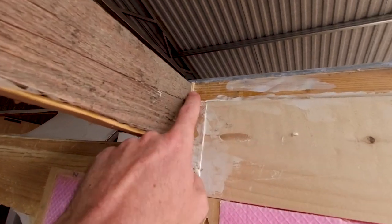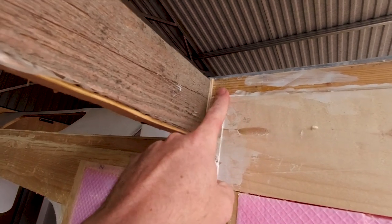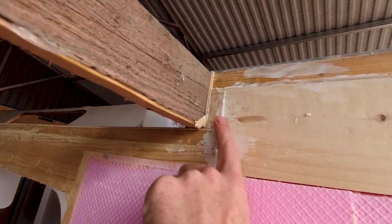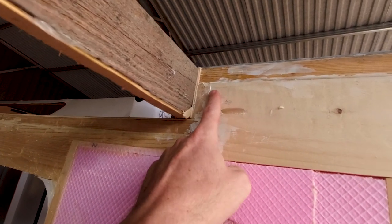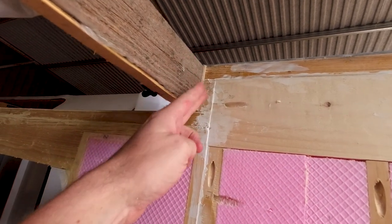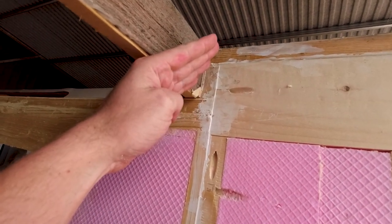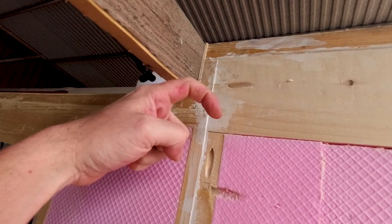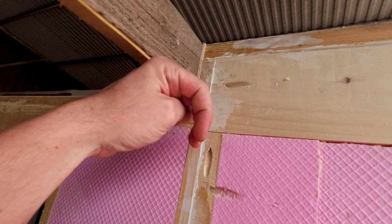And this piece, which you saw me glue on before the front, is overlapping the roof, so there is a tight bond in here. And the inner piece, which I did before putting on the walls and the bottom, I glued from this piece to the roof, so that is a Z shape, which hopefully will prevent this from tilting forward. And that's why I chose to do the pocket hole screws from that angle, so if even the glue fails, this will pull to the front.